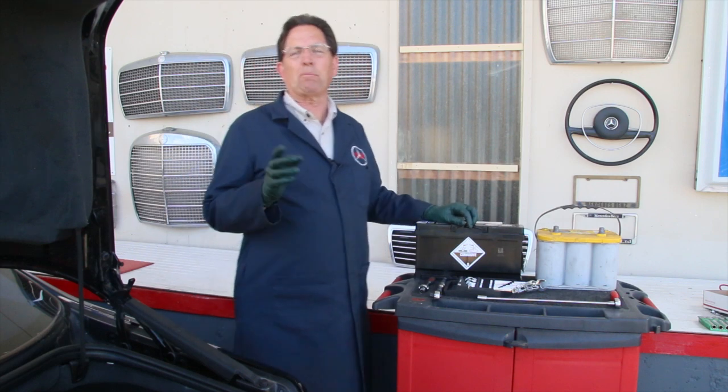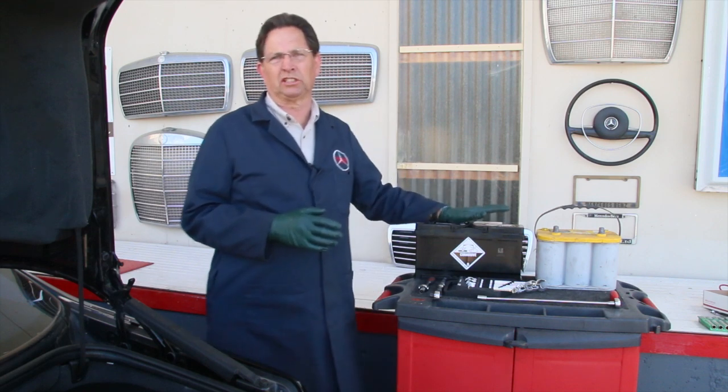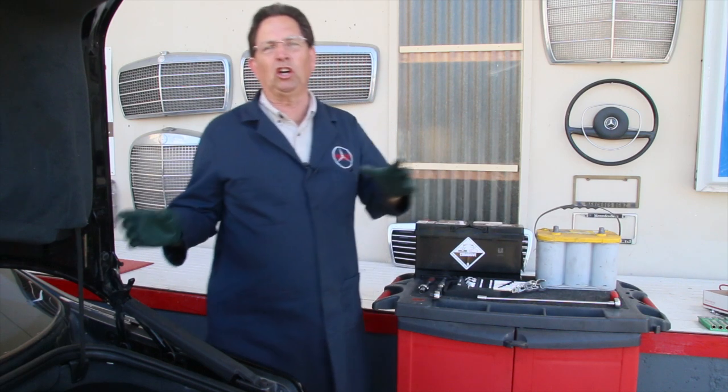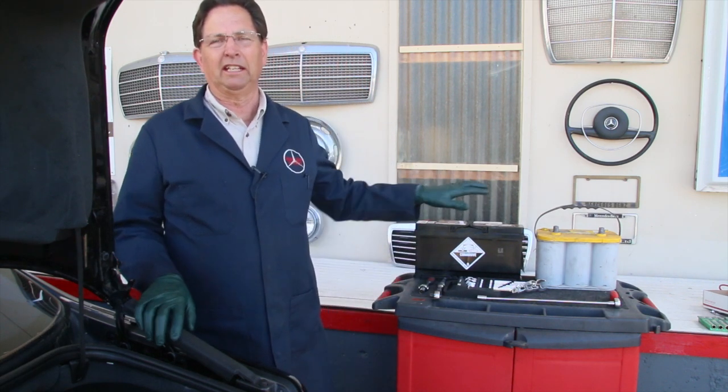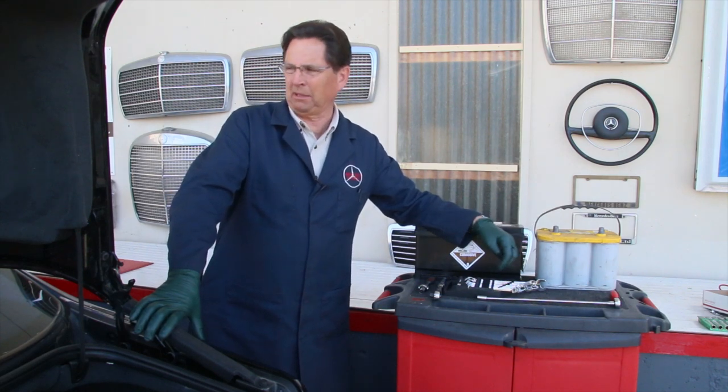In this video, I want to discuss the proper way — and I'm going to emphasize proper way — to replace a battery in one of these newer computer-controlled cars. Beginning about 1996, and particularly after the year 2000, these cars got more and more sophisticated. When you go to change a battery, you do not want to just unhook the old battery and take it out and install a new one. On a complex car with tons of computers, you're going to lose computer memory, lose presets, have warning lights on, and have to reset your climate control, windows, sunroof, and on and on.